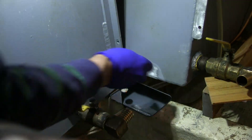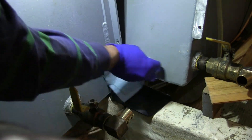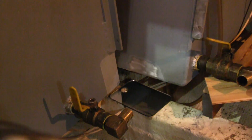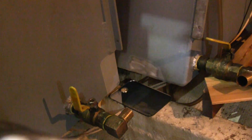With a mirror I was able to see underneath — I felt like a dentist working in areas where I really couldn't see directly. I tilted the tank back so any residual fuel in that tank was not where the leak was; it was all on the far end of the tank. So I propped the tank up so there was no more leaking at this point.